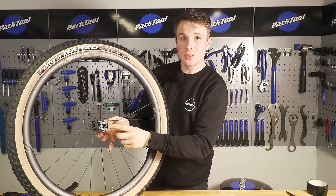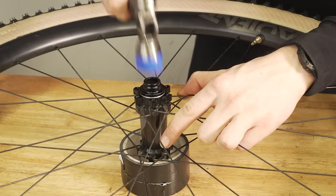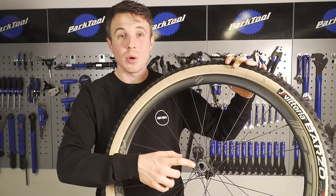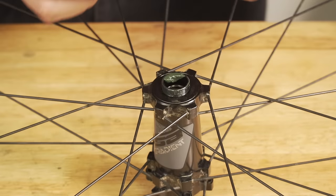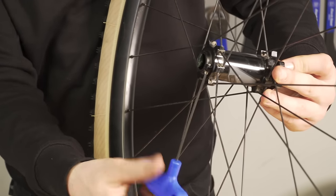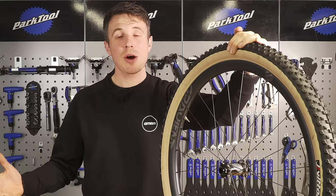You want to make sure you're not going to cause any reason for that bearing to drive out. Then you just tap in very gently with a soft hammer. This is where checking the alignment and making sure it's lubricated comes in — what you don't want is for it to drive out the other bearing due to misalignment. Visually inspect it to make sure it is still seated. The penultimate step is reinstalling your end caps. The final but arguably most important step is to admire your handiwork and spin those bearings.